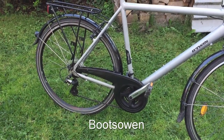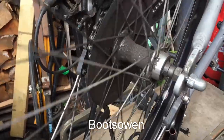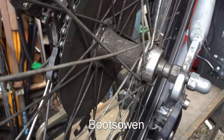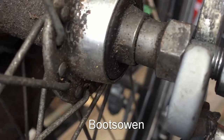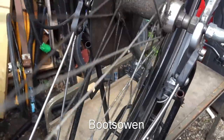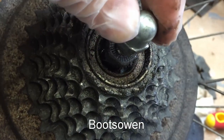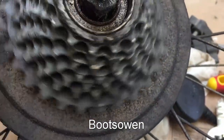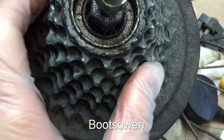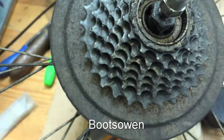Have a look at how bad it is here. It's a really nice bike, but the back wheel's dead. You can hear that noise. The freewheel is not engaging. The bearings are, I think, pooched on that side as well - you can see there. So I'll take it apart and have a look at it. The rim, you see, is running true, which is kind of frustrating - or as good as true anyway. Take it apart and see what's in there. With it off it might not be that bad. It's definitely got bad bearings, but they're not that bad. And this freewheel is definitely chundered up. The bearings in the freewheel are dead. It's engaging there, but look at that - that's not great. So I'll take it off.